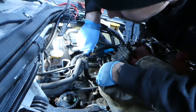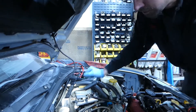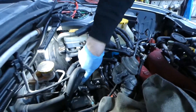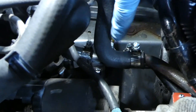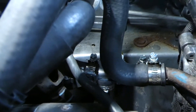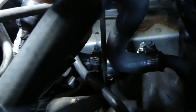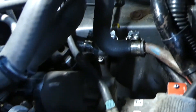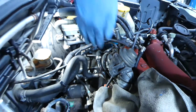Just finished up the fourth cylinder cooling bypass mod — you've seen the little hose dangling off the engine. It comes off the back of the cylinder head and connects to the outlet side of the heater core, which is the lower hose, and that goes to the metal pipe that is the direct feed for the water pump. Now the water pump is getting fresh water directly across the combustion chamber on cylinder four, fixing the overheat issues and hopefully preventing premature failure. The hose goes all the way into the back of the cylinder head into an Allen key plug that's normally there, so flow goes across the cylinder instead of around it.